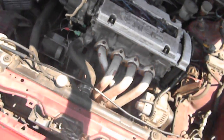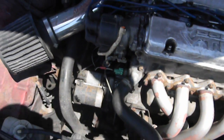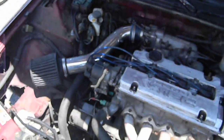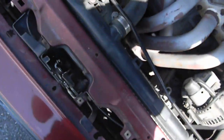It doesn't shoot flames like it's supposed to — it runs very rich. It's supposed to shoot flames, but it only pops if I shift real late. It's got the F-series trans and it's on its way out. I pretty much took all the AC lines out and started tucking the harness on the left side, not really the right side yet. Let me show you the trunk.